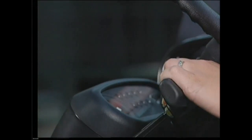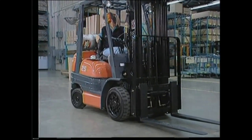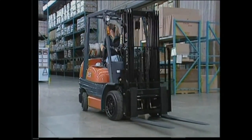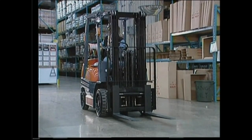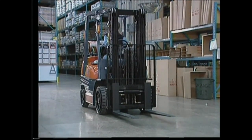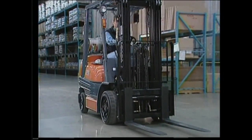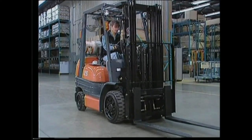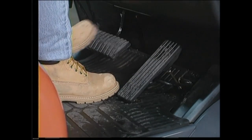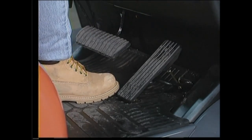Release the parking brake and drive forward or reverse about twenty feet in total, ensuring the steering and brakes are working properly. Check the brakes — the brake pedal must not reach the floorboard. If it does, the brakes are not functioning properly and the truck should be taken out of operation until repaired.